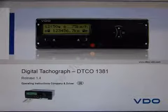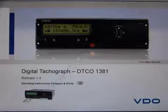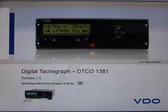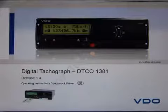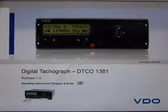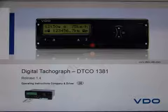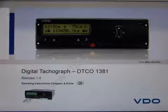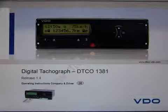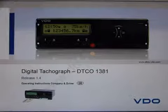Hello and welcome to this short video presentation on the new digital tachograph release 1.4. A number of things have changed, but the one thing you as the driver will notice on a daily basis is the difference in doing your manual entries. They appear different on the screen and it's all done in local time. The unit will still record everything in UTC, but all your inputs will be done in local time. You need to remember that if you move back to a vehicle with an older tachograph, you'll have to revert back to doing it in UTC on that unit.